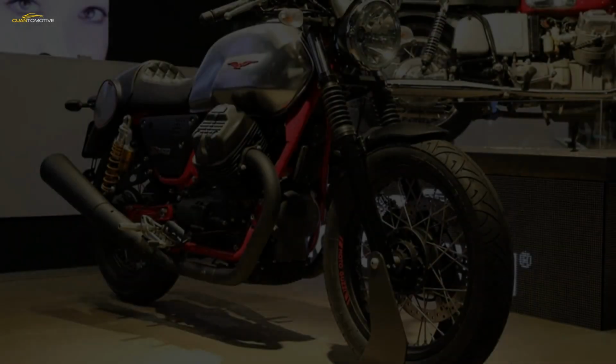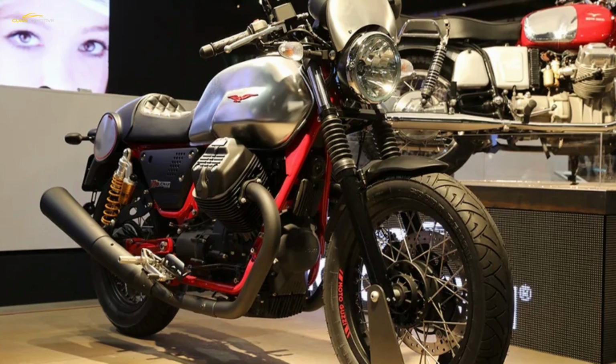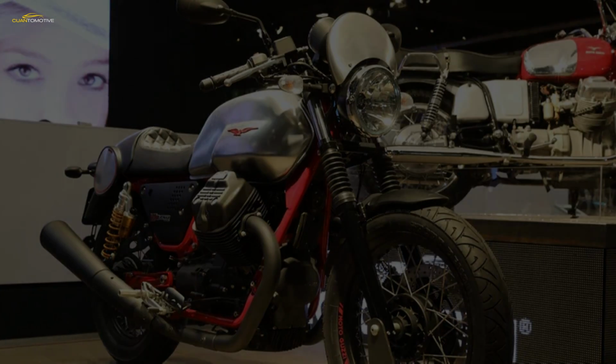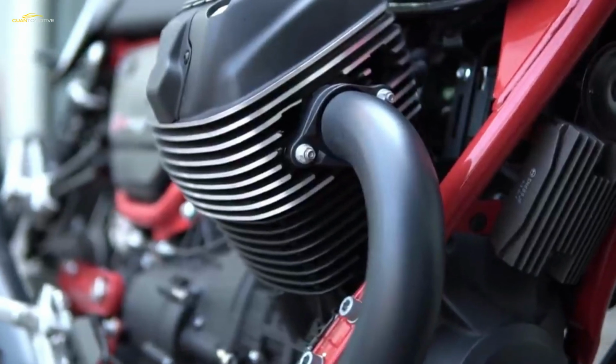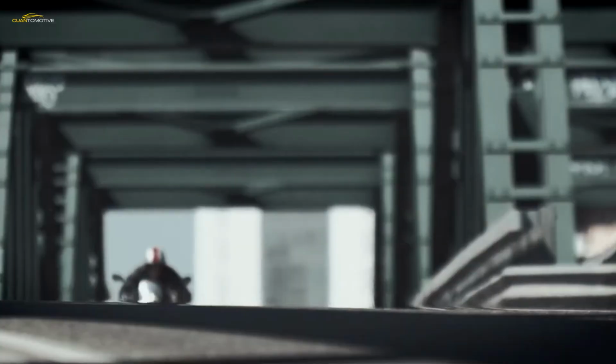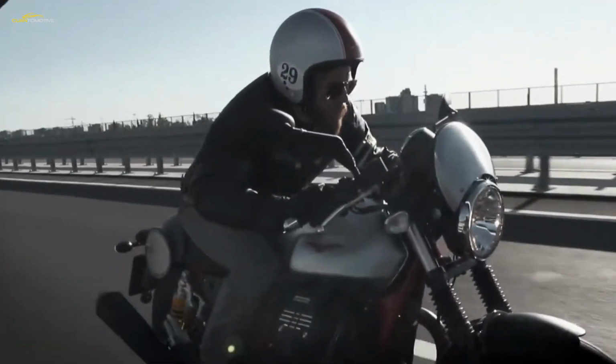Steering geometry indicates a definite flickability to the ride, with a steering head angle of 26.4 degrees and 4.17 inches of trail on a 57.5-inch wheelbase. Even the rider's triangle is set to encourage an aggressive forward-leaning posture, with plenty of room to throw around some body English to take advantage of this newfound agility.